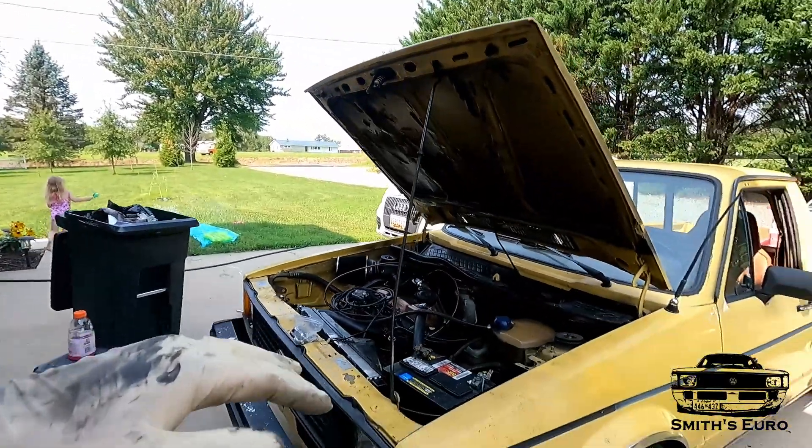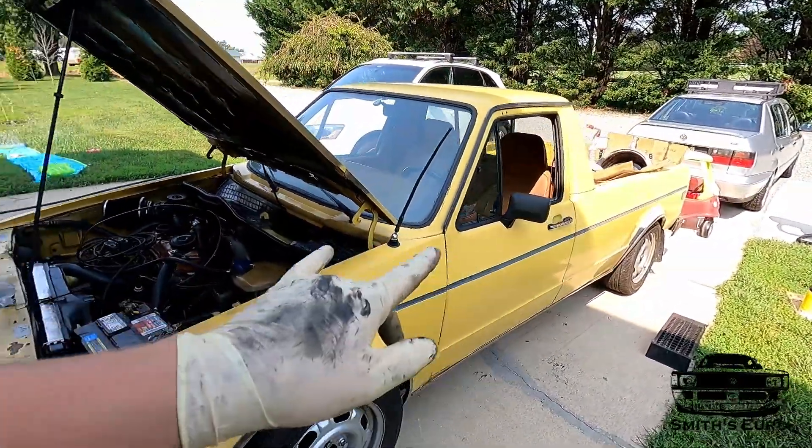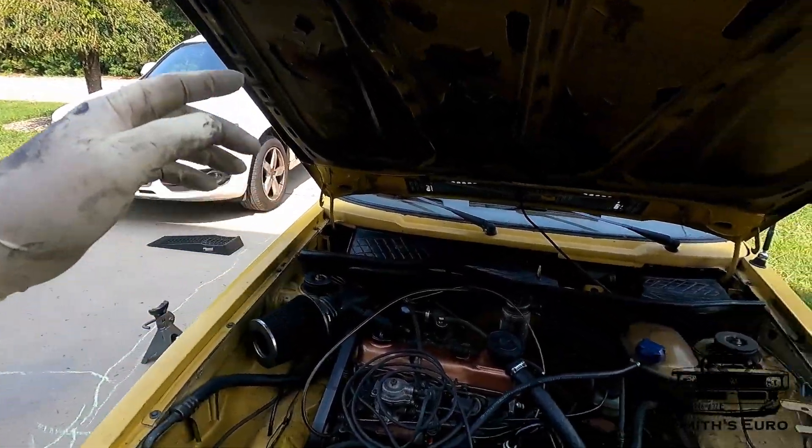We got everything ready — it can be driven now. I also had to get two tires refilled because they were brand new but leaking, so I had to take it and have the bead seals cleaned and get the slime seals put in. The shifter rebuild is good. I drove it — first gear to about 15 mph, second to about 25, third to 35-40. The shift stuff is done.